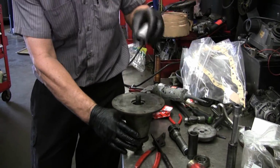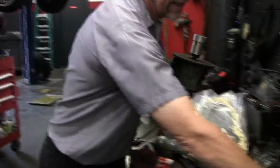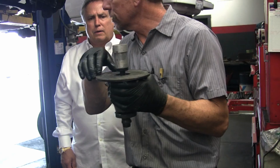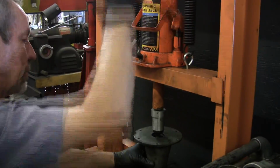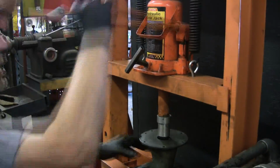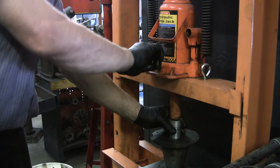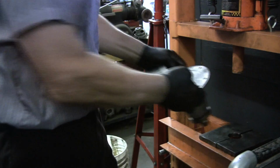All right, so now I'm going to go over the press and press this in. I won't use this thing now because I don't want to press the bearing against the bearings. I'm going to press right directly against this shaft. Now the outside is against the housing, correct, but it's pretty lightweight on that. The center shaft is what I'm worried about. Okay, you keep pumping until you feel some good resistance. So now, we didn't damage this, and now we press the impeller on.